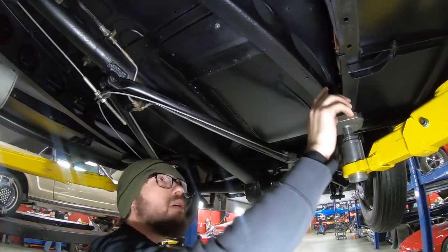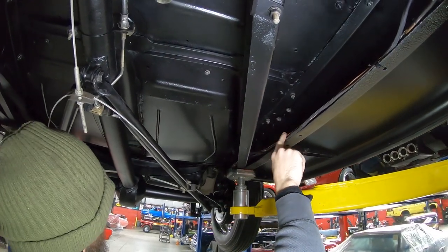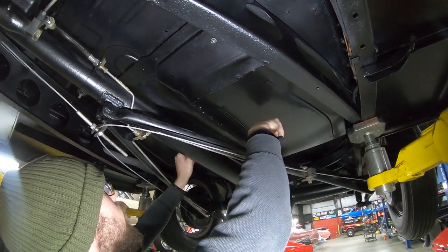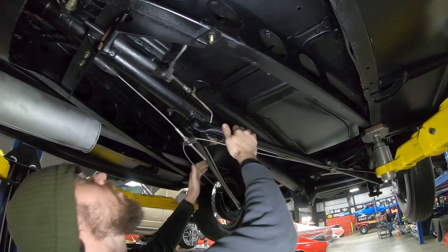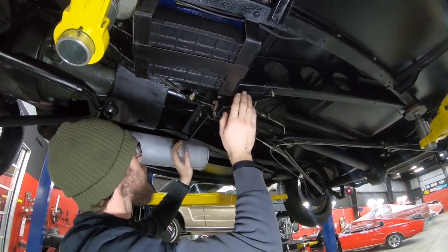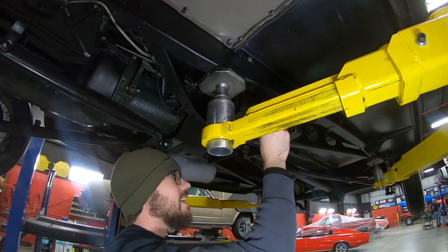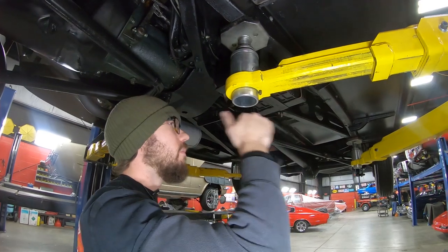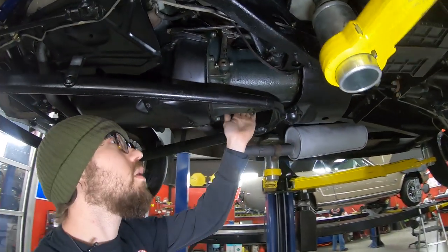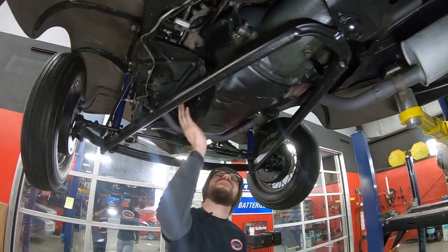The parking brake is hooked up. We've got our fuel line and vapor tube for the fuel gauge — that's actually been replaced, which was necessary for the fuel gauge to be functional, and it is functional. The floor pans look like they've had some work done on both sides — they appear to have been replaced, with original pan sections remaining. Moving forward, here is our master cylinder for the hydraulic brake conversion, bracketed into the frame. This also has a 12-volt conversion done with 1960s Ford parts — a 1960s style generator and voltage regulator mounted under the dash, very neatly done. We also have the original three-speed top loader transmission, and everything is greased.